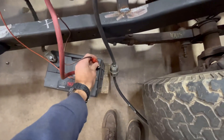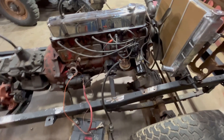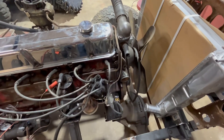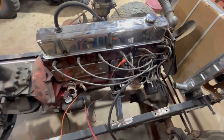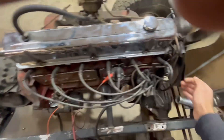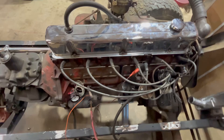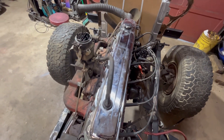When you want to shut it off, just turn the key off. You're not going to hurt it running without water for 30 seconds at a time — you don't want to run it consecutively over and over. Right now I can still put my hand right on the head. You can see a little steam coming out from whatever coolant was still in the head, but I would not ever run it for more than a minute, then let it cool down for quite some time. Compared to the rotary, the diesel, and all the other Jeeps, I just can't believe how smooth and quiet this thing is.